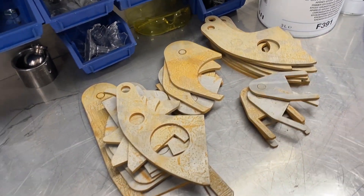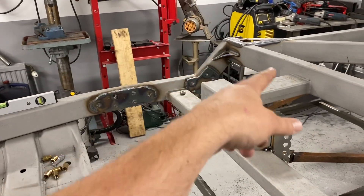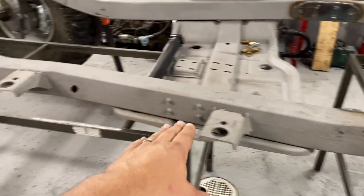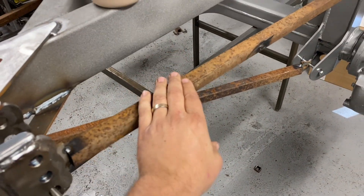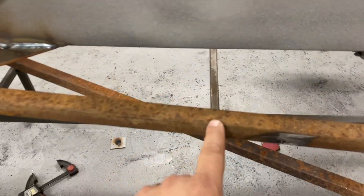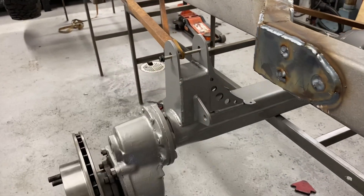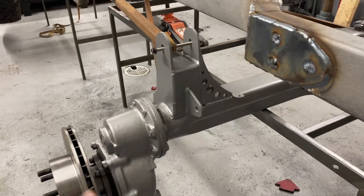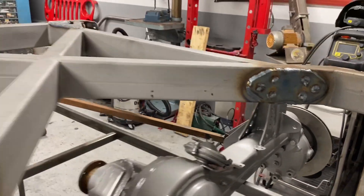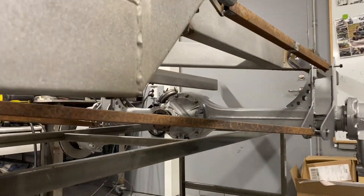Some of the brackets are still on the bench, but most of them have actually been used. The frame differs on the inside — I am going to plate the whole outside as well, all the way to the front. Link brackets have been welded on — mock-up links of course, I might replace those later on, or maybe keep the rusted ones, we'll see. The rear axle is also done; these are the brackets that we cut and they are now fitted to the axle, fully welded, painted and so on. It is coming along quite nicely, and so far everything fits as planned — we'll see how long that continues.